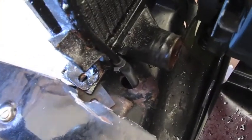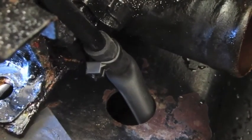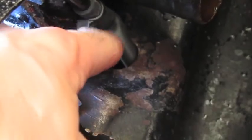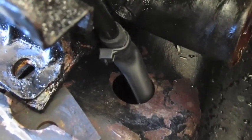As a follow-up on putting this tube on the overflow for the Model A radiator: there's a hole in the frame at the front. When you're putting the radiator back in, make sure you guide the tube through that hole as you put it back together — it should come out on the bottom. You can see the tube hanging from the bottom of the Model A, which means you've successfully threaded it through the hole. Now you can bolt down the radiator and put it back together.